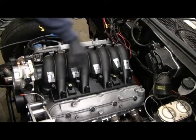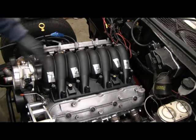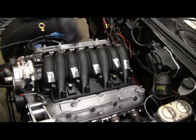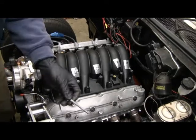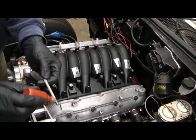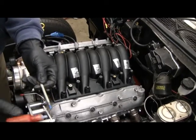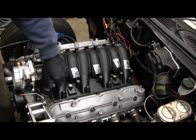The tape with the numbers here — I put that on there as a little cheat. That is the torque sequence. There's ten bolts, five on one side, five on the other. These are the intake bolts. The assembly manual suggests some thread locker on them, so I'm going to go ahead and do that, and put all ten of them in, starting them by hand.